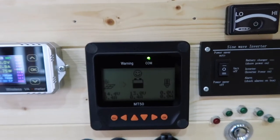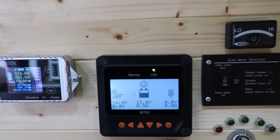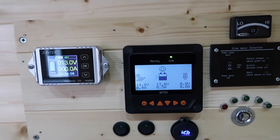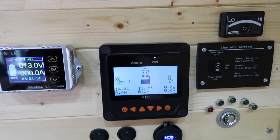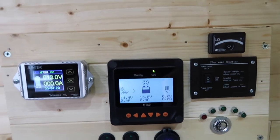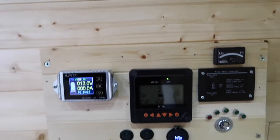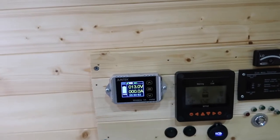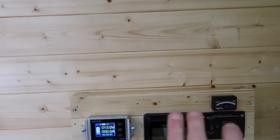Moving on, we've got the solar controller that you see on everyone's vans. This one just allows you to remote control the solar controllers that are under all the gubbins there, in the powerhouse section. On this van, I've got 700 watts of solar. There are four panels, 175 watts each. So you've got two panels running one into the other, providing a 350 watt dual system.